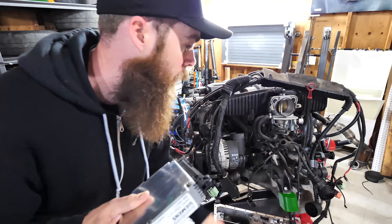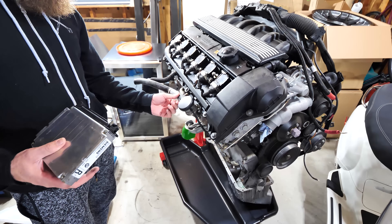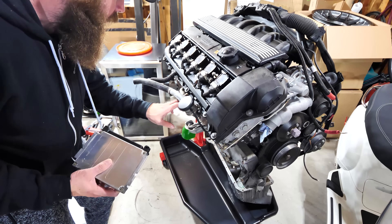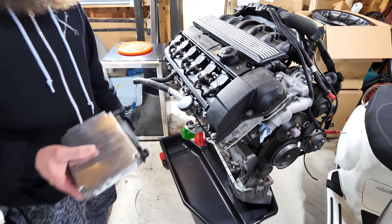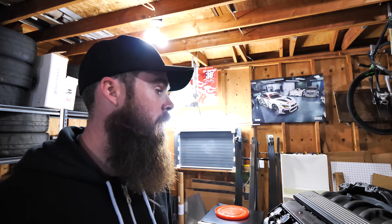This EGR stuff right here is kind of heavy. I'm going to remove that, and also the secondary cat, so we've got to get those programmed out as well — that'll go into the ECU tune. I'm going to send the whole wiring harness out to them to have the pros do it, make it super clean. You could do it yourself by comparing the two wiring diagrams. I want to keep this car OBD2.